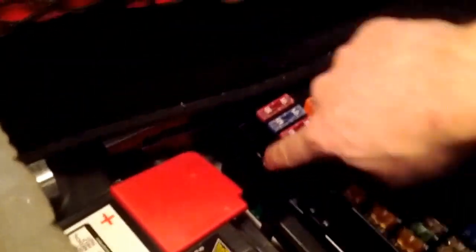Basically this sheet of paper is folded and it's located over here — just fold it in there. I tried all four fuses, and basically the two middle fuses on that list, fuse 28 and 31, when I pulled them out the headlights went off.